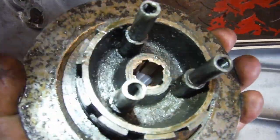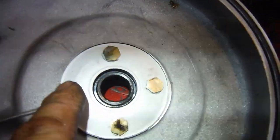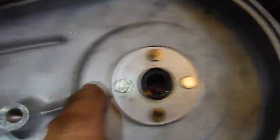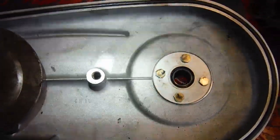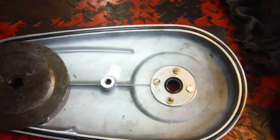One of these three posts that the pressure plate spring bolts screw into has a little bit of a burr on the back of it sticking up, and also we can see marks on the heads of these little bolts that hold this seal assembly, and these are also loose. The back of the clutch centre basically has been catching on these three, which are slightly raised, and obviously they've been interfering with each other, and that's where the lockup has come from. So, that's a big relief from a full gearbox rebuild or the gearbox locking up.